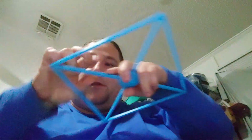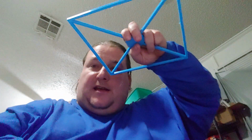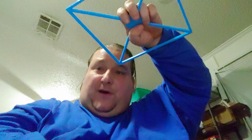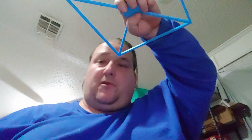So what they do is they put the 3 end stop switches at the top. The printer goes to the top and goes click, click, click, and it homes all 3 motors. And now, because you had previously defined the 0, 0, 0 of the bed, it then goes from that point where you define 0, and it moves up to home and says, okay, how many steps for each motor?